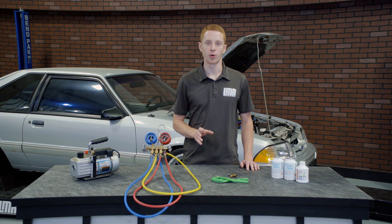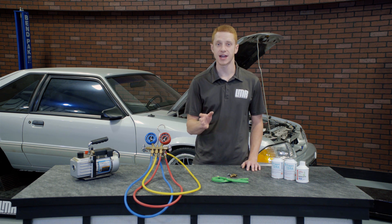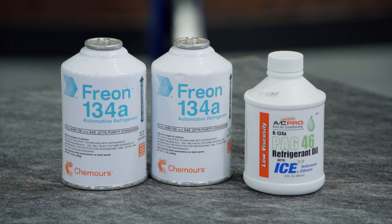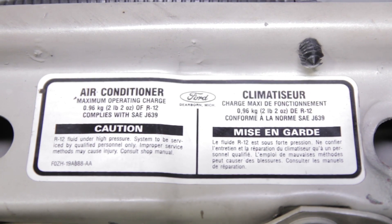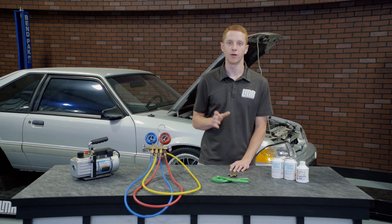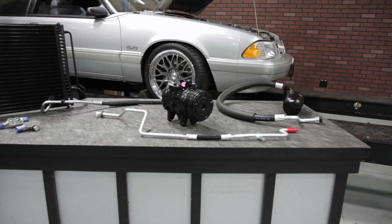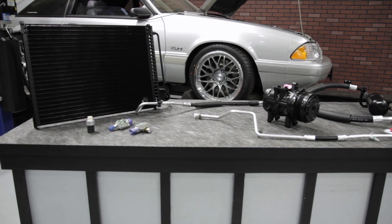Before doing this it is important to have some common knowledge on how an AC system works and to have a licensed HVAC technician properly empty your system. You'll want to have on hand some PAG oil or charge oil and a few bottles of R134A refrigerant. Be sure and consult your owner's manual or the underhood sticker to see how much your system takes. In our case, this Fox body has an R12 weight amount, which is going to be slightly different because the system has been converted to R134A refrigerant using a premium 50 Resto conversion kit.